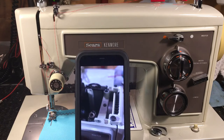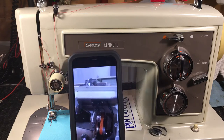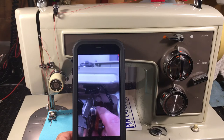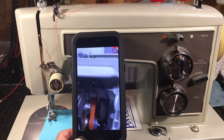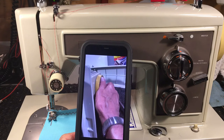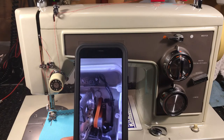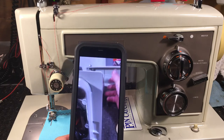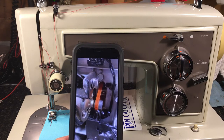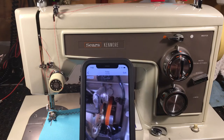After you put your side cover on and put your screws in, the last step is to tighten up the motor. Slide it down the bracket — just real easy. Put a screwdriver over here, slide it down, and tighten it so it's got a little slack. When you release the hand wheel you want the motor to run at high speed to keep it cool, then when you engage the clutch it'll run at a good speed. You can turn the hand wheel and it shouldn't labor — that takes care of getting the belt at the right tension.